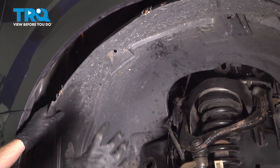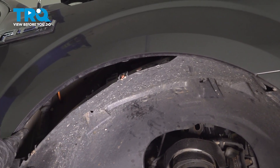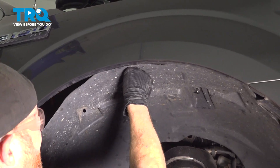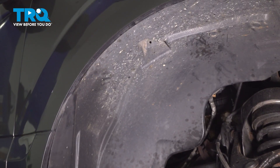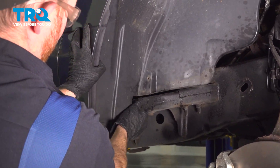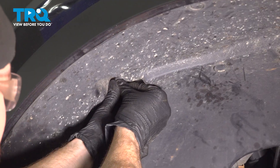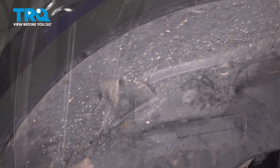It's time to start getting the fender liner back in place. We're going to press this inward, slide it up and in behind the areas of the fender that it needs to sit. Once we have it properly placed, we can continue on with our push clips. Let's line up our push pin holes and press those in. These can be a little tight — you might need to tap them in with a hammer.